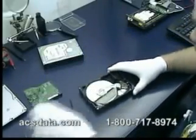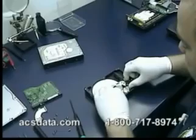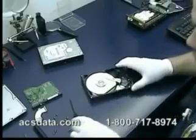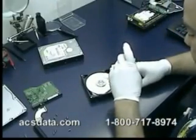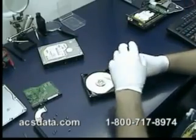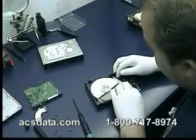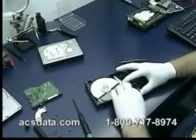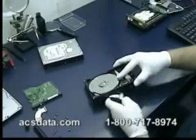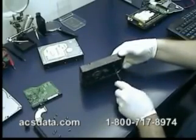Pulling off the top magnet. All we need to do is move the heads off of the parking area just slightly so that we can remove the limiter. Removing this limiter will actually allow us to slide the heads off of the platter. Now we have the heads removed from the platters, and we'll go ahead and remove the bottom screw that holds the heads in place.